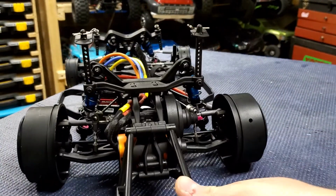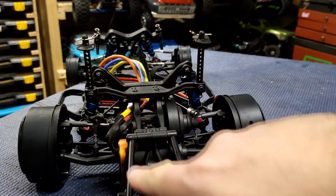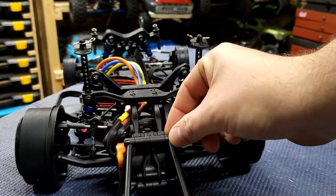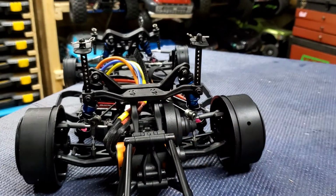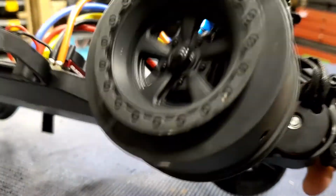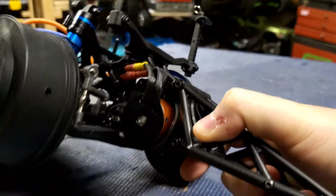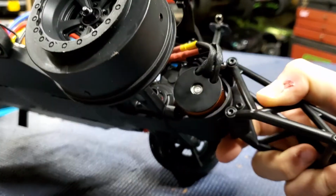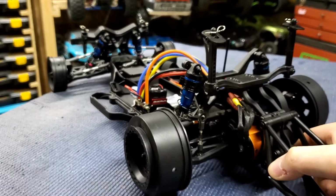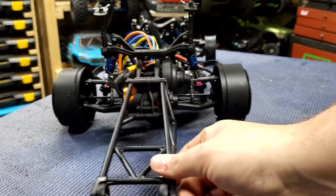Pull it around here and you can see it's mounted in, the bar itself is mounted top and bottom, so 4 locations with 45 millimeter through bolts and lock nuts. But the mount itself, let's see if I can zoom in here. The mount itself is sturdy and attaches directly to the motor guard, but it could go one of 2 ways, and knowing me, I put it together wrong the first try.